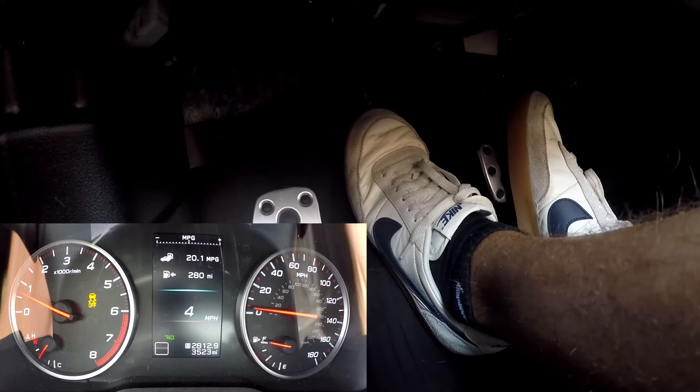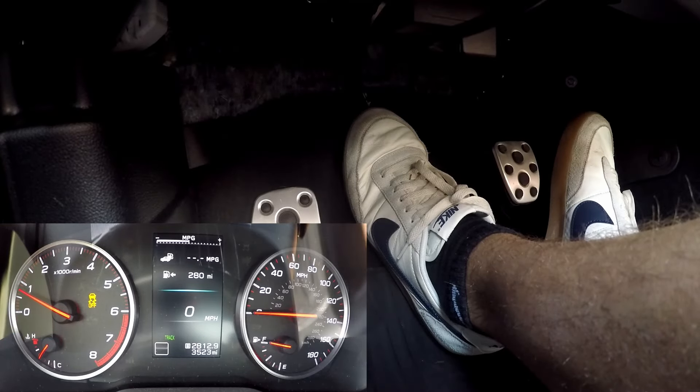When you launch the car, we're mainly using the clutch to control the way it launches. In the past, we modulated both gas and clutch, but with launch control you can keep your foot down on the gas and just modulate with the clutch pedal. We'll do a 3,800 RPM launch, and after we launch it we'll use the flat foot shift feature as well so you can see how smooth it is. Stay on launch control for a second, let the car build a little bit of boost, then watch what I do with my feet.